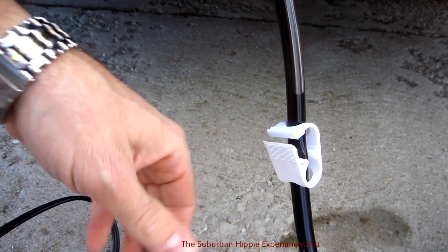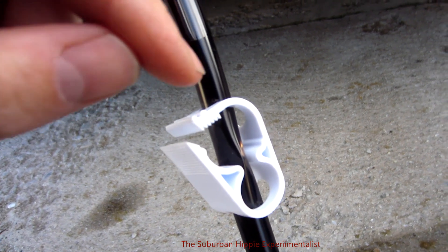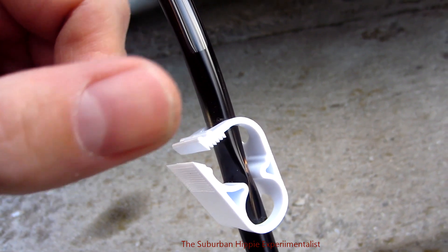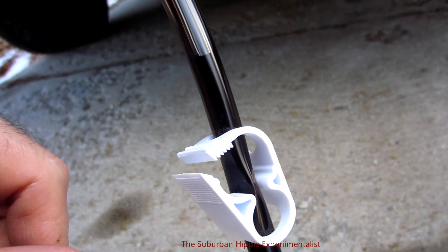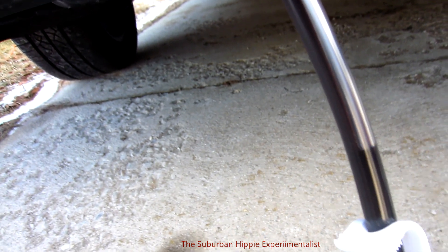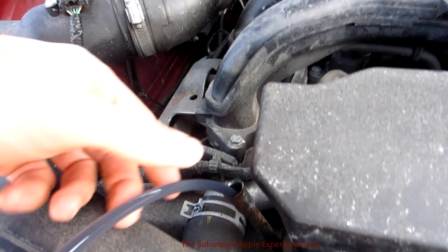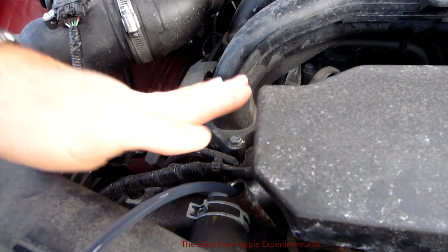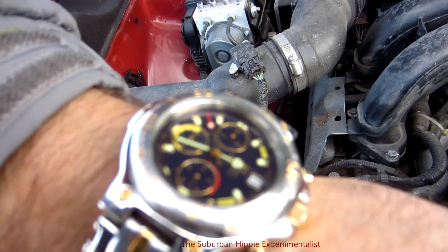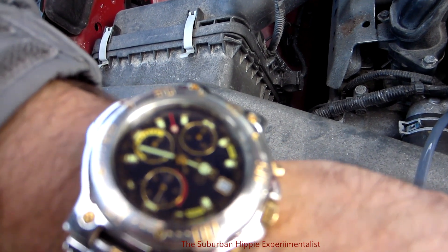You need three clicks to stop the hose off — push it once, push it again, push it a third time. It's draining now; it pulled oil right away. I pushed the tube down in until it stopped. I could have pushed it a little longer in the dipstick, but I got the impression it was curling up in there, which I don't think you want. It looks like it's 17 to 3, so we'll see how long this takes.